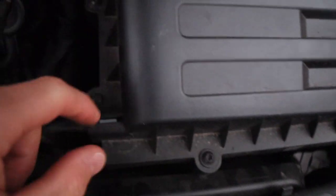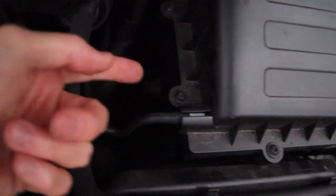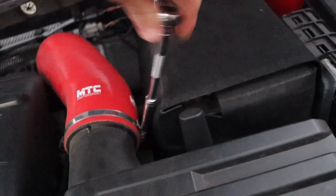I believe if we take this off, that bad boy is gonna replace it. Hopefully take this off which will lead the cold air feed through there. I'm going to take the screws off, undo the jubilee, pull that off, separate this and then just have a look. There's fixings there and there, and a cable tie for the battery supply. So grab the TX and start cracking these off - seven mil, we're gonna loosen this off.